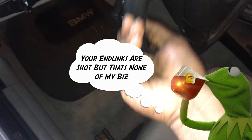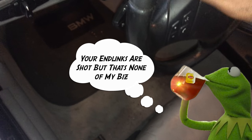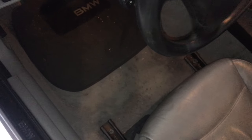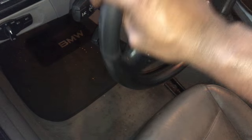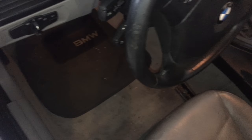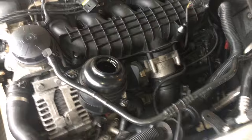Now I need to go inside the car, turn the steering wheel, and get the air out of the system. It's been a lot harder to do since the car isn't running right now. Steering went down a bit, so I'm going to go ahead and add some more fluid.